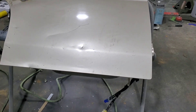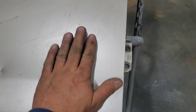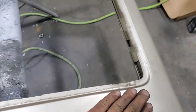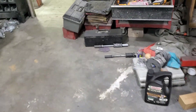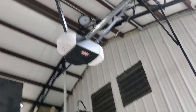I went ahead and unbolted the door and brought it over to my door hanger painter thing. I've got a dent there, a dent there, a couple little door dings, and a big dent right here — that's going to be fun to fix. I'll have to slide hammer that out; there's no opening anywhere to get to it. The top feels rough and there's all this mess where I've been welding inside — that is going to be a nightmare. If I can get that smooth I can paint it blue; if not, I will probably paint the entire vehicle pearl white.